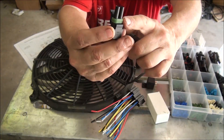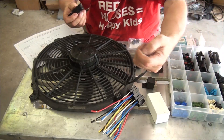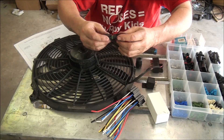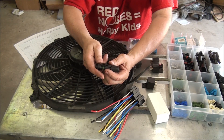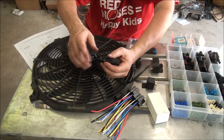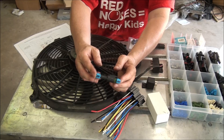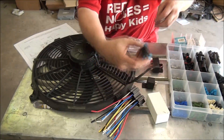It's got this rubber seal that when you plug them together keeps the environment out of the contacts. At the ends where the wires go in, it has these little rubber seals that go in and seal it. When you put them all together it's completely weather sealed, protecting it from corrosion. The weather packs are smaller — I think they're rated at about 14 or 15 amps. I'm going to check the amp draw of this fan to see whether this is sufficient. If it's not, I'll go to the next bump up which is a metro pack — also weatherproof but a more robust unit with a higher amperage rating, though slightly bulkier.